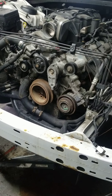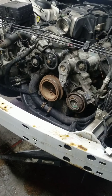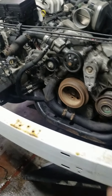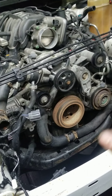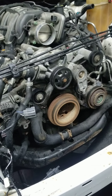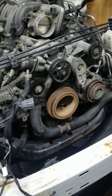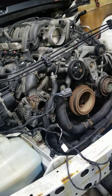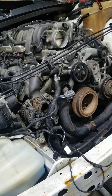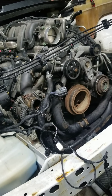I'm going to do a very thorough inspection. Once you get the timing cover off these engines, there are actually two openings in the oil pan gasket where you can see down into the pan. I can get my hand down in there and I'm going to wipe the bottom of the pan with my fingers and see if there's any metal shavings stuck to the bottom of that oil pan. If there's not, there's a great chance that this engine did not get damaged by the failed oil pump. He said the oil pressure dropped to zero and he probably rode on it for about a half a mile, then shut it off and had it towed home — just long enough to get off the highway so he wouldn't get hit. It's been sitting ever since and he hasn't started it since.